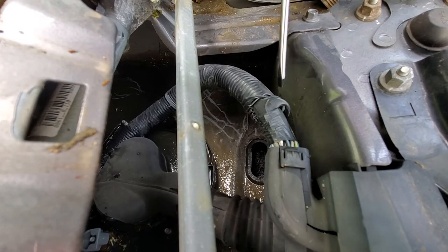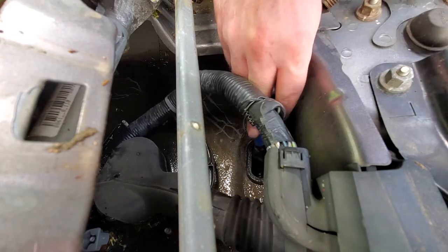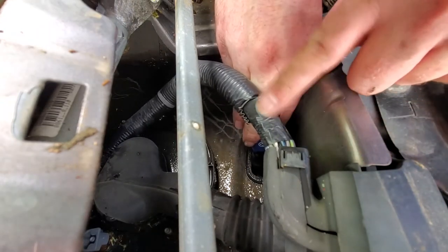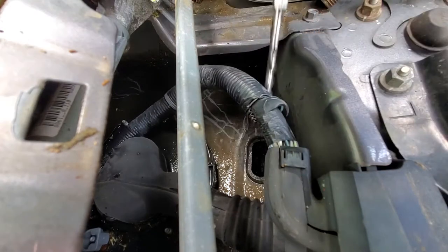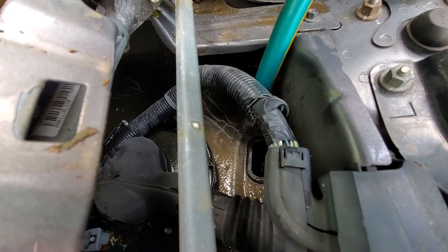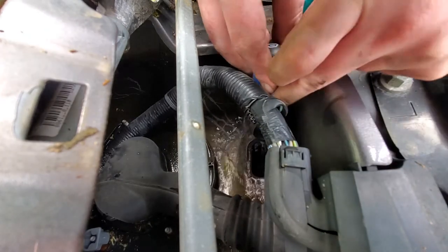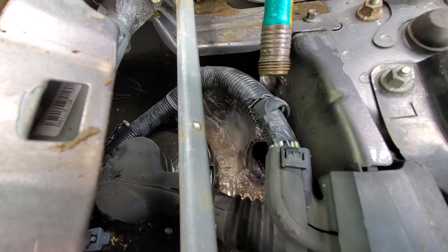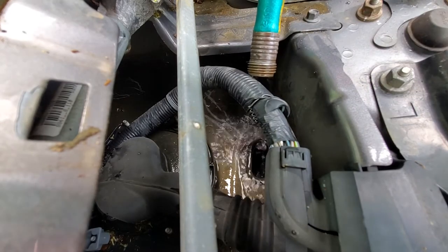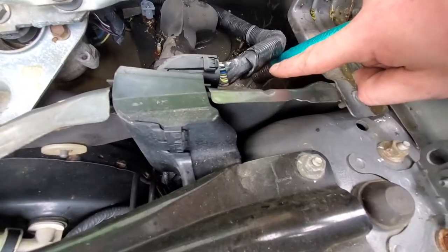Here on the driver's side, right here's the screwdriver and right here's the grommet. Pull the screwdriver down and you'll see where we're at. We just carefully work around this — these might be brittle; you really don't want to break this wire harness. That was really dirty. Let me turn some water on so we can rinse this hole out. Working in tight spaces is not my forte — I've smashed my head on this hood I don't know how many times. There we go, and in case you're wondering where this guy drains to — see the water gushing out? That's where this cowl drains.